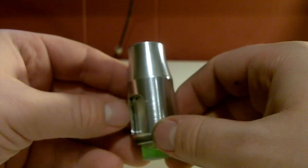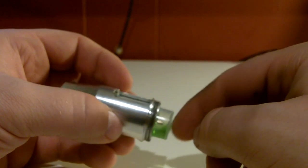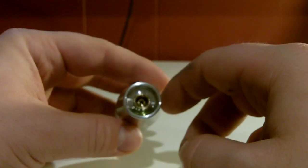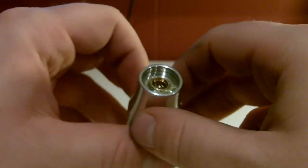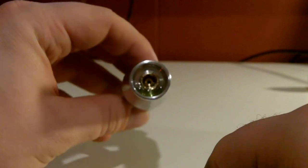The top piece is quite a bit more complex. You can kind of see a little line here — there are separate pieces inside and outside, part of which helps insulate the device. The 6ml juice bottle screws in the bottom. Protruding here is the feed tube — a solid metal tube that runs up to the atomizer. At the top we've got a nice recessed juice well and the 510 atomizer connection. You can see some juice has pooled up in there; it takes a lot to really get this juice out. One of the changes Justin is intending to make is to actually bevel this at an angle so juice flows better back to the atomizer, much like common bottom feeders on the market.